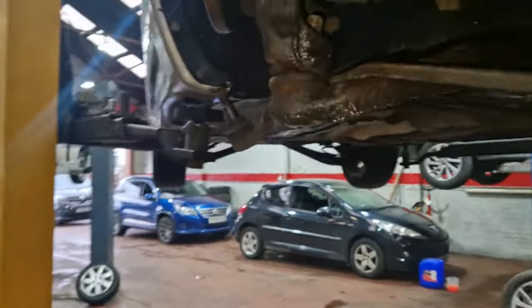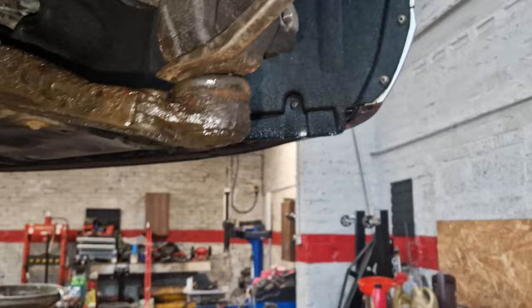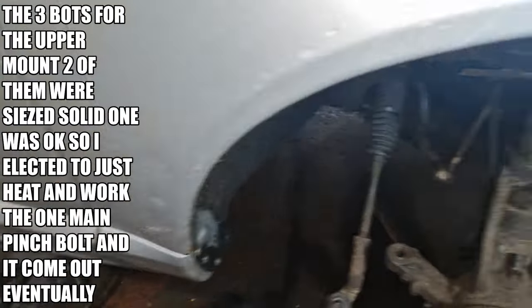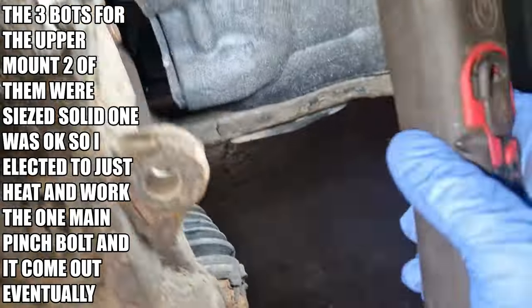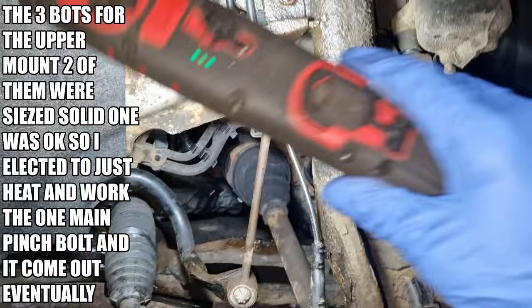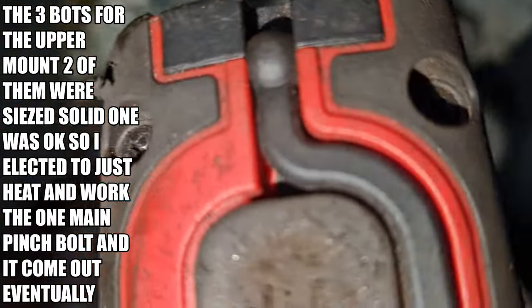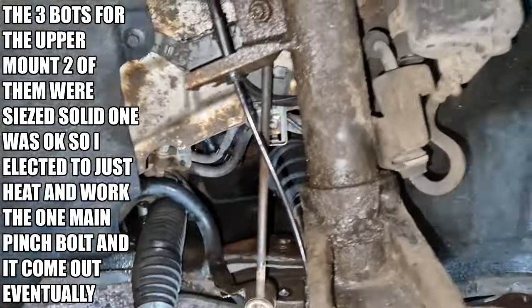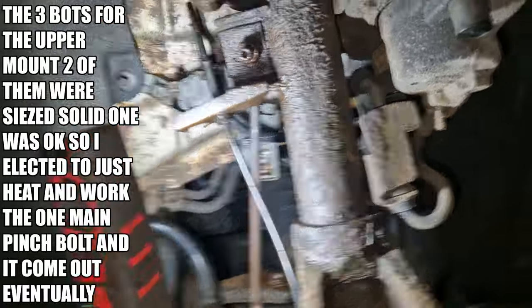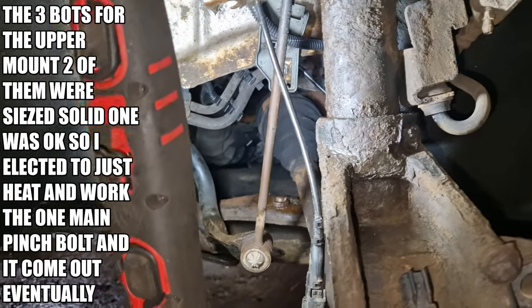I'm not getting a good grip on it. You've all seen it — incredibly bad. I've got the Volvo partially stripped. I've popped this off just to see and there are three bolts holding the top mount which is holding your strut into the car. I've been at this bolt for the back — it's a pinch bolt which pinches this hub onto the strut. On older cars, don't just send that with a gun or you could break it and then you'd need to drill it out, re-tap it, and put the same bolt back in. I'll probably just nut and bolt it.